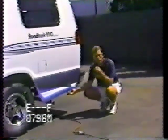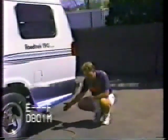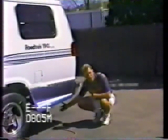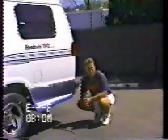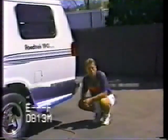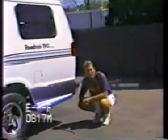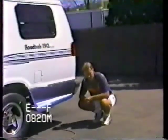Inside you have the switch that turns the generator on and off, which has the hour gauge. If you want to come out and check the oil, you have to lay down, pull the little cover off, check the oil, and put it all back together. Make sure you don't lower the unit into a lake or a river — it's not really designed for complete submersion. Otherwise, running over water or rain is not going to hurt it; it's fairly waterproof.